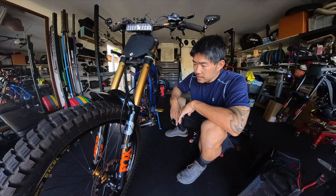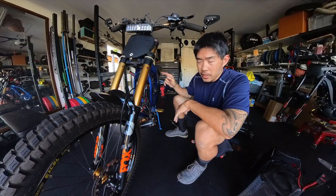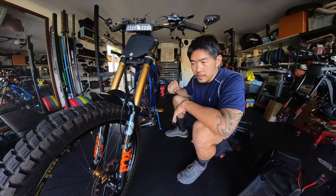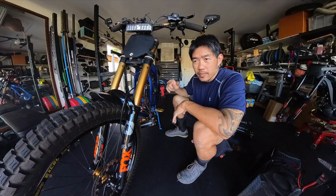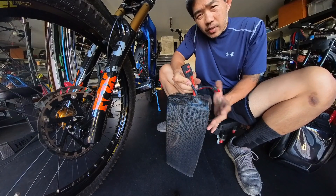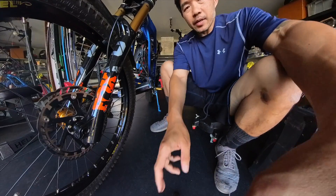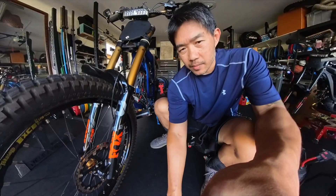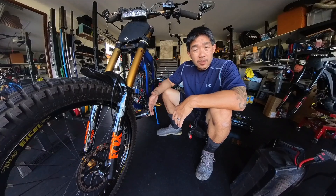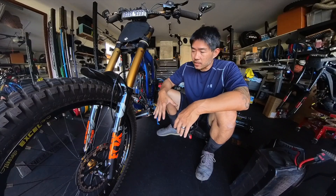Welcome back to my channel Nuts and Bolts. Right now I'm in the middle of taking off my circuit breaker and putting in the QS8 connector. I just came back from changing the QS8 connector on my battery — these are anti-spark connectors, so you don't need the circuit breaker. The reason I'm doing this is because my circuit breaker constantly pops on me. Before, it popped at about 60 miles an hour, then maybe 55, but just yesterday it popped at about 38 miles an hour and it cut three times at all different speeds.